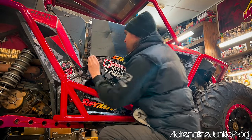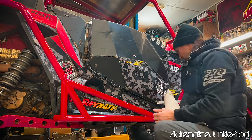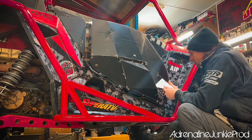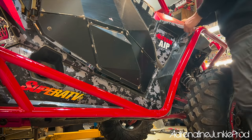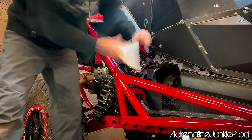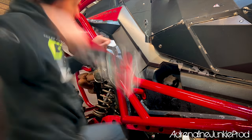With thinner lower quality adhesive materials, you'll notice you can't get these long big pieces off. It'll start to tear — when you pull on it, it'll stretch and break. Then you'll basically be left with hundreds of small stickers to peel off, versus these big panels coming off in nice large sections. A cheap adhesive will also leave a lot more residue on the surface, which turns into a huge nightmare to clean.